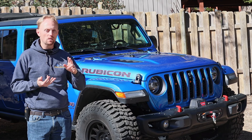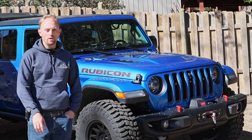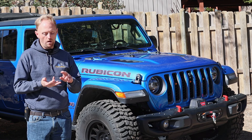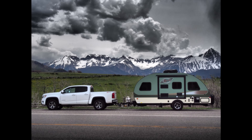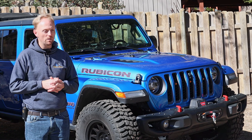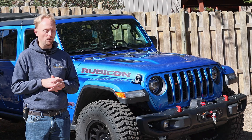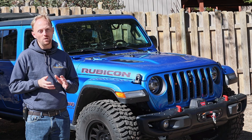I've owned quite a few other trucks — full-size and mid-size. How does this compare? Compared to other midsize trucks, it holds its own pretty well. Jeep did a great job engineering the suspension, chassis, and wheelbase for stability. Compared to a Colorado with the same 3.6 liter gas engine, this tows as good or better, mostly because the ZF 8-speed is way better than the Colorado's transmission. If you want the best towing midsize truck, you might look at a Ford Ranger, since the EcoBoost engines have so much low-end torque — almost diesel-like. If you want a midsize truck just for towing and aren't concerned with off-road ability, maybe look at the Ranger.